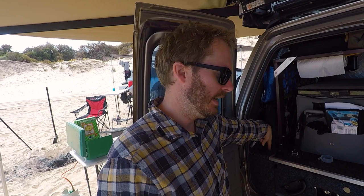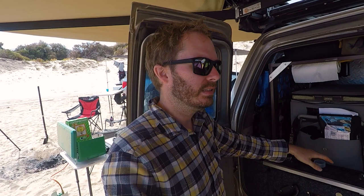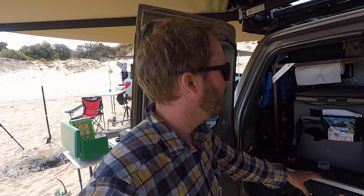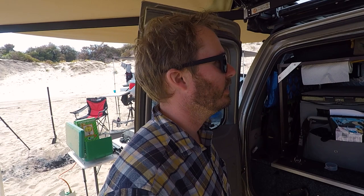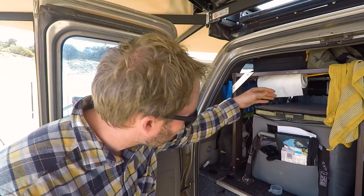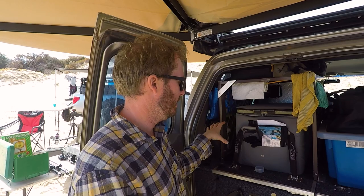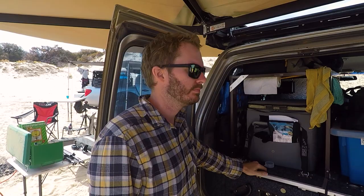The battery setup consists of a 58 amp-hour AGM under the side floor kit and another 58 amp-hour on top of it, both joined in parallel giving 116 amp-hours total. There's no fancy lighting setup. There's an Anderson plug for solar input, and behind the fridge cage there's a Projecta 25-amp DC-to-DC charger that takes charge from the front to charge the two rear batteries, with the Anderson plug serving as the solar input.